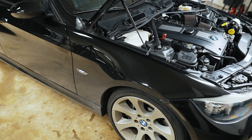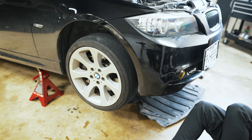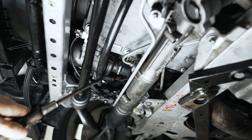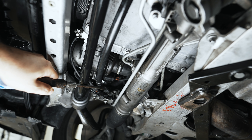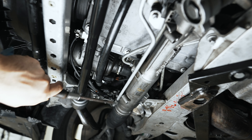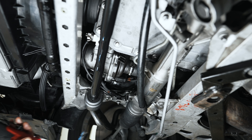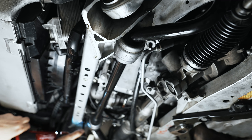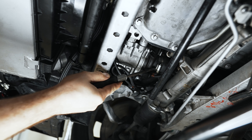We're going to get the car jacked up and start from underneath. Zip out the undertray — as you can see, there's the water pump. The sway bar is in the way, and so is this power steering cooler line. Normally you'd put a 10mm on here and hold the top with a 17mm wrench, but this one is already ripped so there's just a zip tie. Loosen that with a 10mm and 17mm wrench and remove the line out of the way.